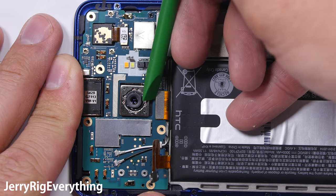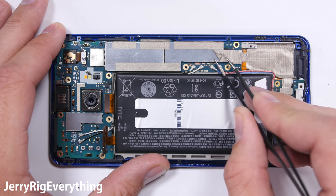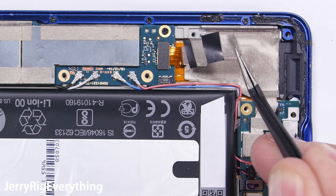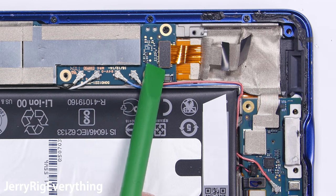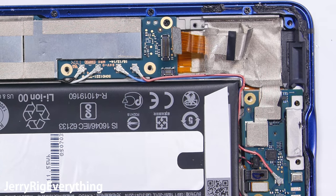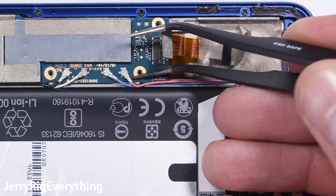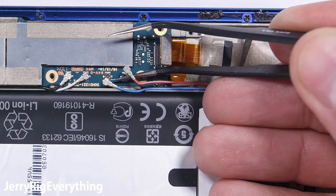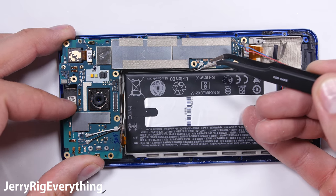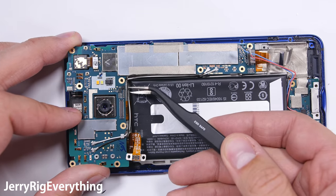There's one more Lego connector at the top of the battery for the screen, and then one at the base of the motherboard under this silver metallic tape. This phone is actually incredibly simple to work on when compared to the HTC 10. The HTC 10 was way overly complicated with tons of ribbons, so I'm glad HTC simplified this version. There are two more screws holding down the motherboard — these are normal Phillips head screws. I'll pop off some of the little signal wires and then the motherboard can be lifted up. Be careful with the other signal wires though — slow and gentle is a good thing.